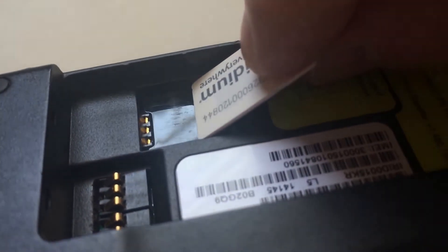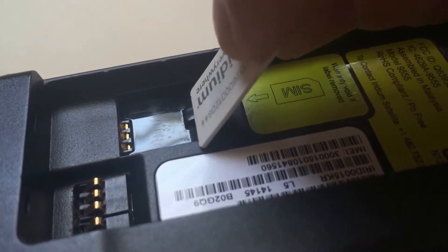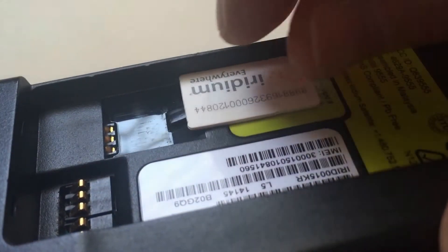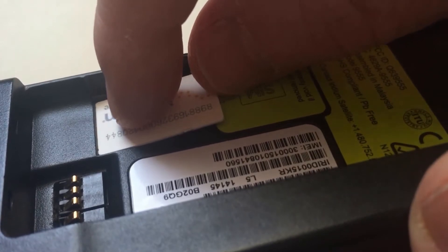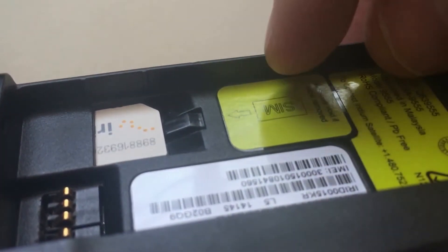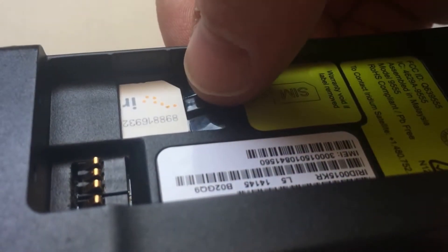What you want to do instead is let it glide along the track. The piece in the front is the snap that holds it in place. So what you want to do is guide it along that track and just ease it in. You don't have to force it — just let it flow right into that spot, and then kind of push it from the back with your thumb. Then in the front, not even applying that much pressure, just slowly press it in. You'll hear it snap, and it's actually in front of the SIM card holder that holds it in place.